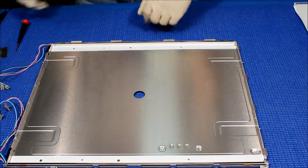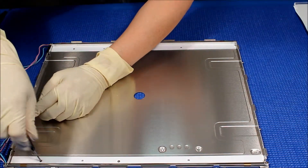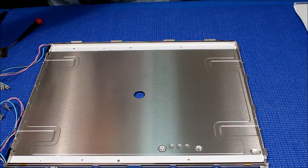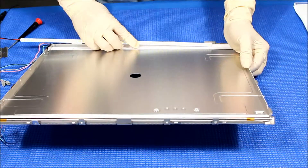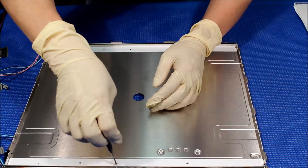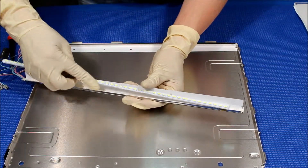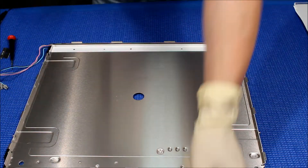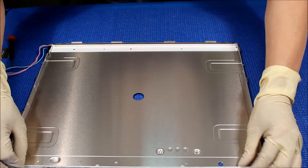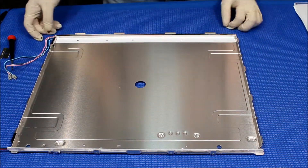Now, there's a small screw that's holding the backlight assembly. Well, before we move that, I want to show you here — it's not gonna fit inside the reflector, but I'll show you later when I take it out in front, you can see better. Okay, take this UB70 series out. It's gonna be way too big to fit in here. In that case, we are not gonna use the original reflectors. As a matter of fact, we're gonna mount it here. That way we can use the whole back assembly as a heat sink.